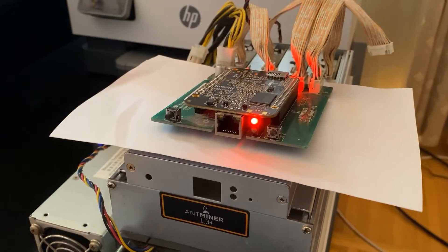We obviously don't want that. How these miners get infected is you either bought a miner from somebody you don't know, or you downloaded firmware online from an unreliable source, and suddenly a day, a few hours, or even a week later your miner is mining for somebody else. Every time you change the pool address it changes back, or it doesn't let you change it. You try to reinstall the firmware and get an error message, you try to flash with an SD card and the SD port doesn't work, you keep getting red failed LED flashing. Also, if you get one miner with a virus and all your miners have the same factory password, these viruses spread to your other miners.